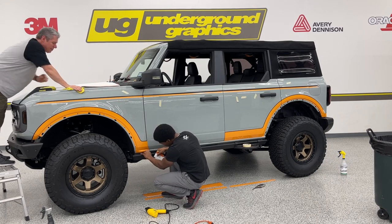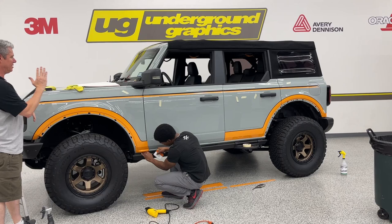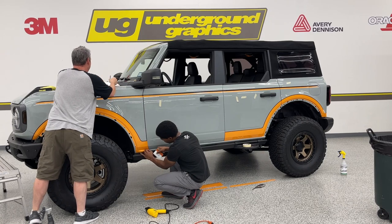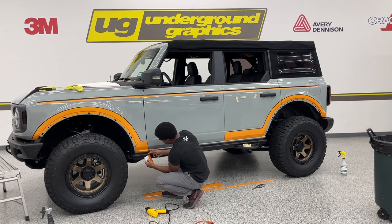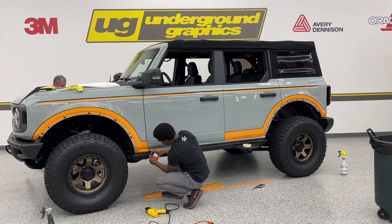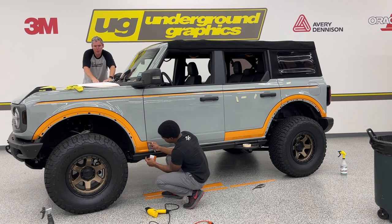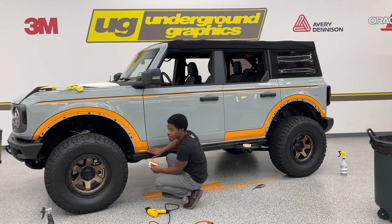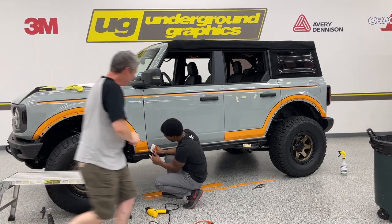And you want to, again, use that tape and kind of go back and forth, but that's your lineup. The top of that hood, top of that graphic is cut to match the shape of the top of that hood, or the back of the hood for that bump. Big key, don't rush your edges, because it is possible to get them to buckle. So you want to be good and patient when you're laying edges down, because you don't want to have to pull those back up.